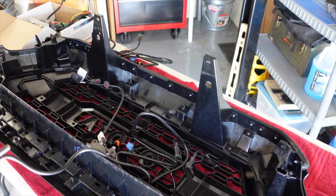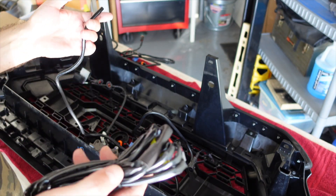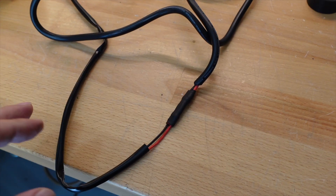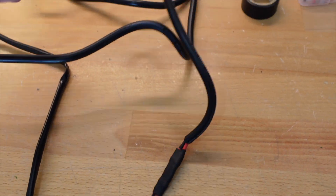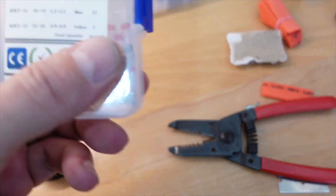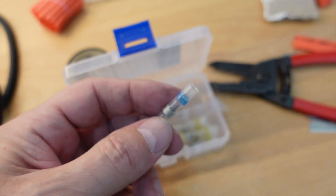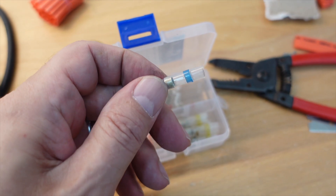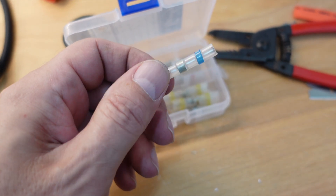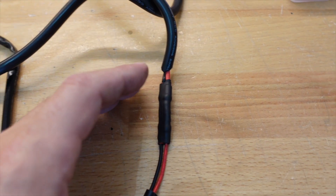That's what I really like about that wireless controller — it makes it very easy. I'm just going to go ahead and splice these together, get them plugged in, and that's pretty much it. I just have to tie the wiring down under here with zip ties and then that'll be the install. For those interested in the guts of it: I used solder seal connectors. You feed the wires into both ends, heat it up, and the solder right in the middle melts, joining the wires. The little blue areas also melt to grip the wire sheath. Then I used heat shrink over the top of everything with a heat gun. You have to be careful — they get really, really hot.